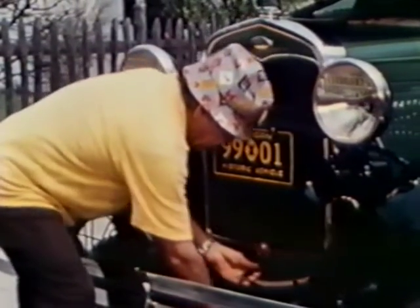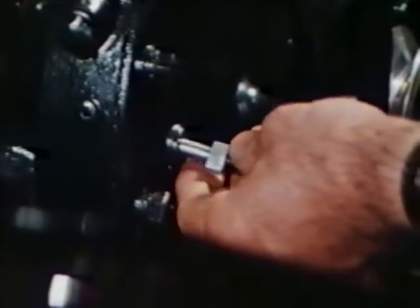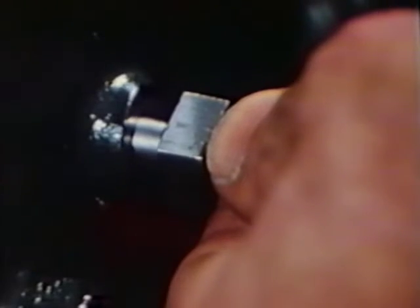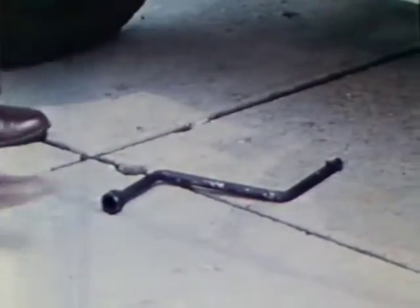Well, that's the initial preparation. Now let's set the number one piston at its firing position and start timing the engine. Remove the timing pin from the timing gear housing, reverse it, and while pressing inward on it, turn the engine over slowly until you feel the pin drop inward into a small depression in the timing gear. Remove the crank completely and lay it on the ground in front of the car. Also, turn the pin around into its original position and tighten — unless, of course, you prefer an engine compartment full of oil.